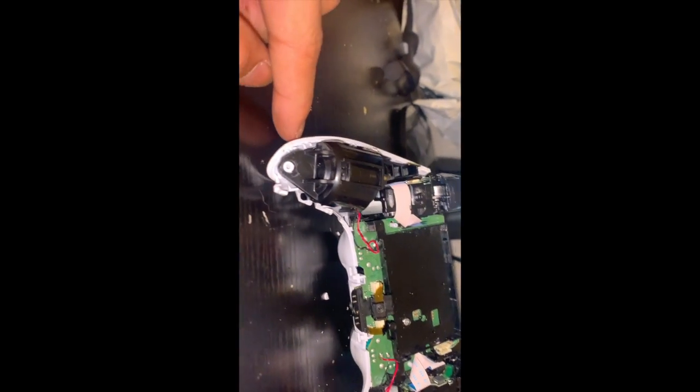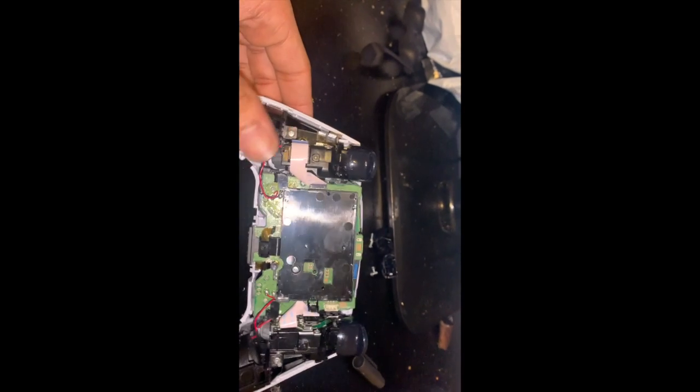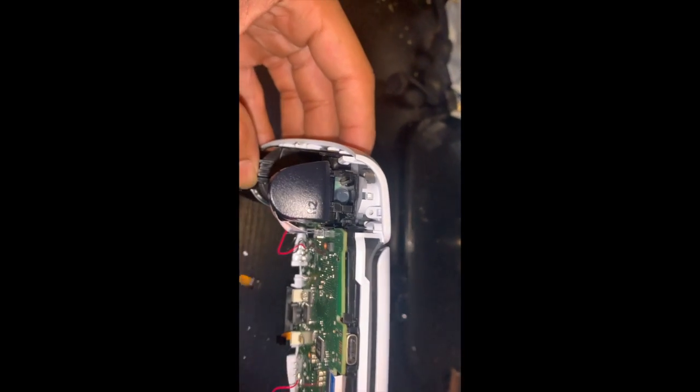Now in this image I'm showing you — when you pop the battery out, all that's left is this black piece and this screw, and I'm giving you another angle right here. You got your blue piece up top, you can pop that wire out; you got your two wires down here — your microphone and your receptor wire — you want to pop those wires out. Now on each side of the controller, where your palms and fingers lay when you hold it, you gotta unscrew that screw. Same thing for the other side, as you can see right here in this clip.